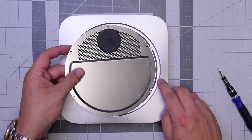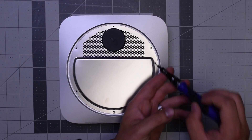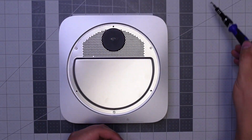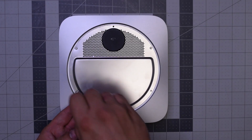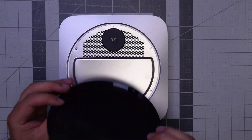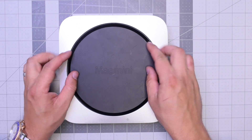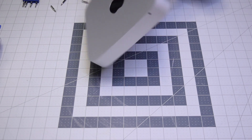Align the Wi-Fi antenna cover and secure the three wider, longer post TR6 screws first, then the other three smaller TR6 screws. With those connected, place back the cover, making sure to align the cover holes with the longer TR6 screws, then clip it into place. Flip the unit back over and we're done.